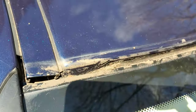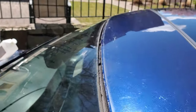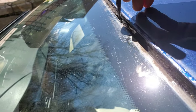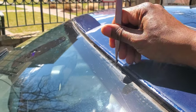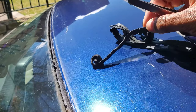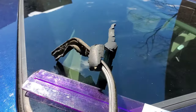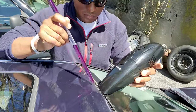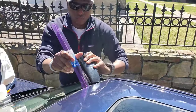Once you see your strip is cracking, just replace it right away. There's a lot of dust in the channel that you will have to clean out as well. The old weatherstrip is finally off — you can see the rubber bit and the metal strip that goes in the channel. That rubber part is glued or taped onto the metal. You're going to need your handheld vacuum because inside the channel is going to be a lot of dust, especially if it's brittle and been sitting there a long time.